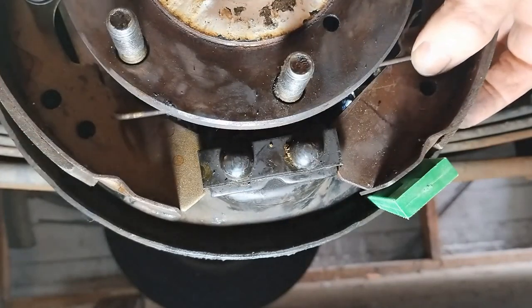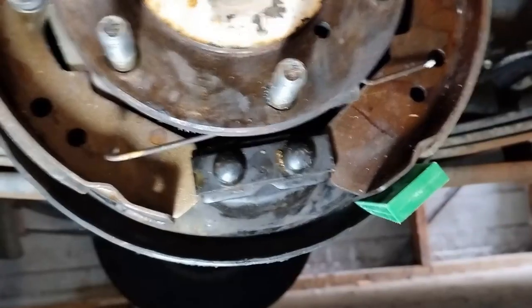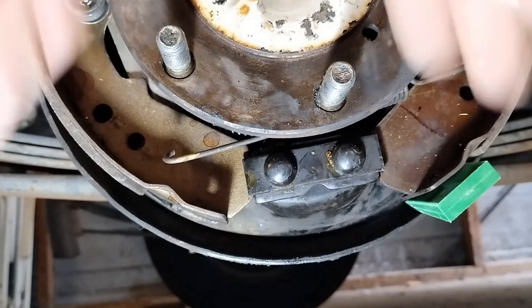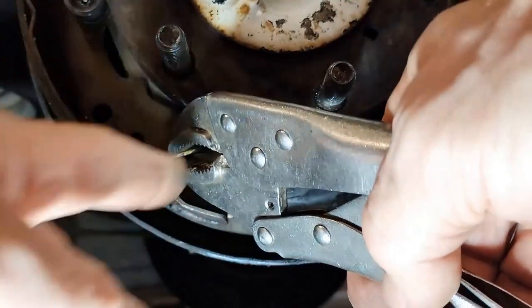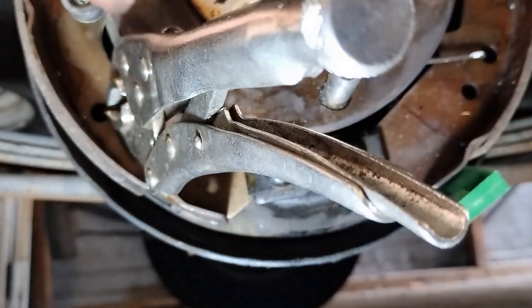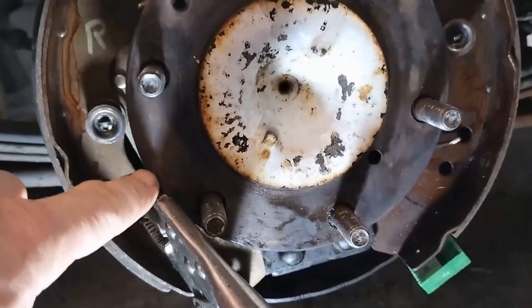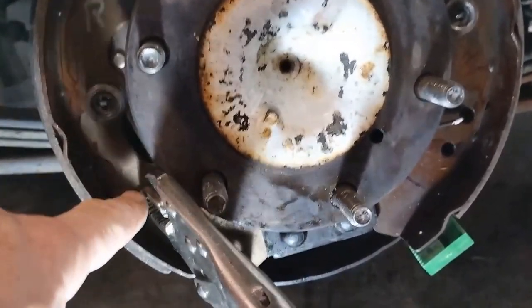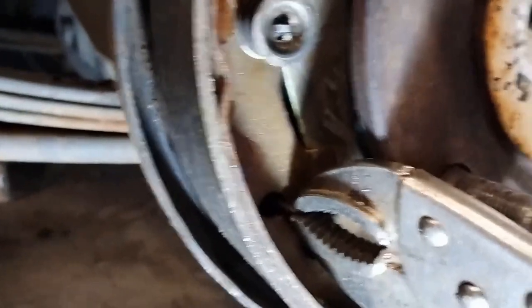Now, this is the hard part because we've got to get that from there to there, and it's a fairly tough spring. Okay, as I say, I did this work about 5 years ago. Now, I think the trick was to use these big pliers and grab the tang at the front there and, yeah, that's right, that's how I did it. I used this round bit for leverage, and I pushed the handles back in and the spring went in, so that's now done that bit of work. If I can just release these,